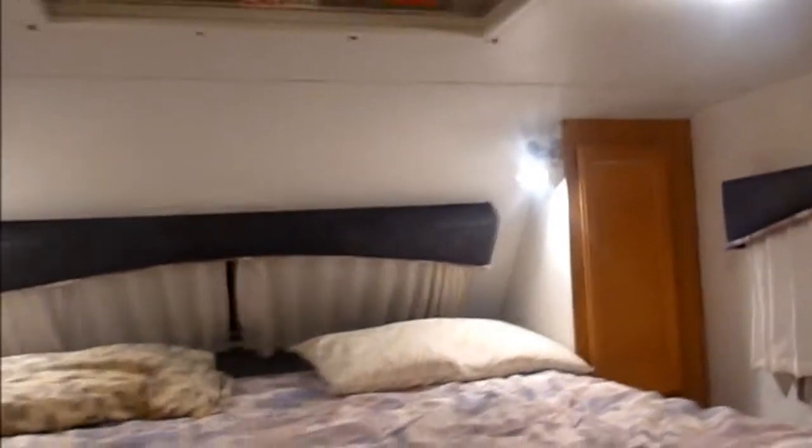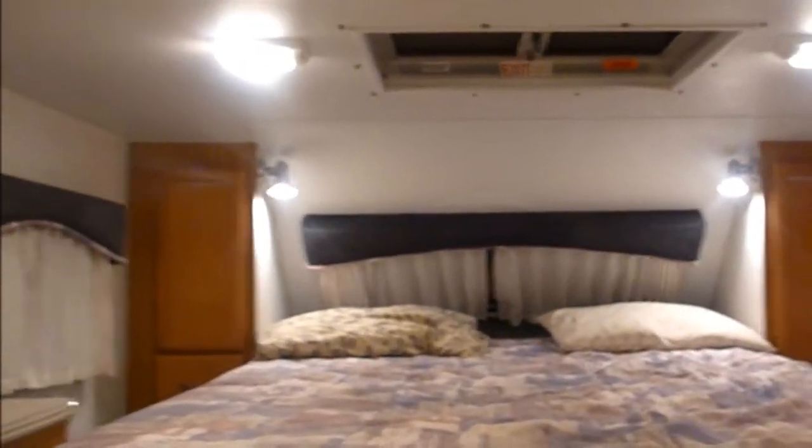The reason I'm here tonight is I'm going to be installing a stereo. There are little tabs there and reading lamps up on the roof — one up there, one up there — and those actually have wires behind them and framework for five-and-a-quarter car speakers. Right here there's framework behind this panel for a car stereo. I just have to pull that panel out and all the wires are there, the electricity is there, everything's ready to go.